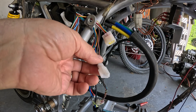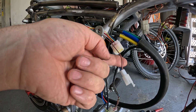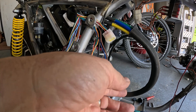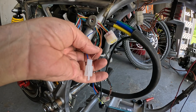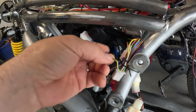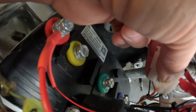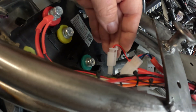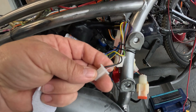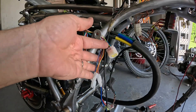For the boost wire: if we ground this brown wire, it will start a timer and we can have fun power for a certain amount of time — just like a video game. After that time expires, there's a penalty wait before you can use it again. This brown wire — I think it's pin six — has to be assigned to boost and grounded. I repinned and stole the black wire that was with the low brake and put it on the same plug as the brown wire, so two wires go to the button and it touches ground to the brown wire to start the boost. So we're using that wire, a throttle wire, and the hall wire — that's it.